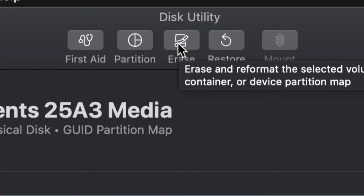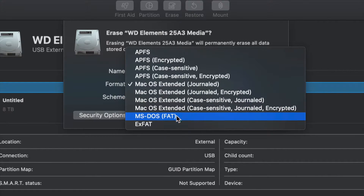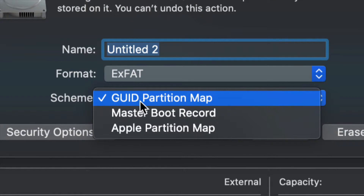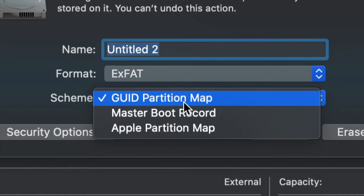From here we're going to erase. Erase is on the top - your third option will be 'Erase.' Erase means formatting, which again means deleting everything from within the external hard drive. Once you click on Erase, this is the most important part: for most of you, pick exFAT. Just make sure we keep it under Master Boot Record, because later on if you want to partition it we'll still be able to.